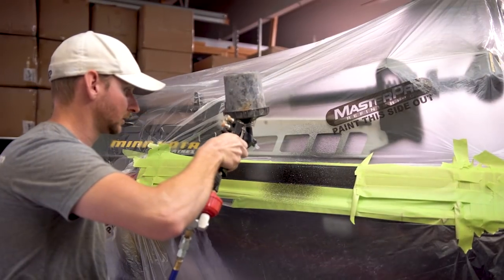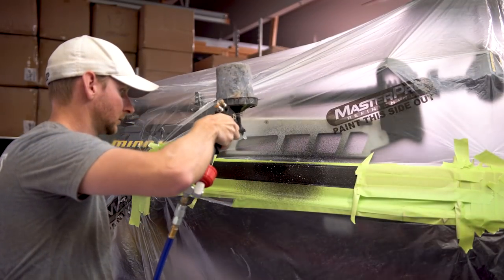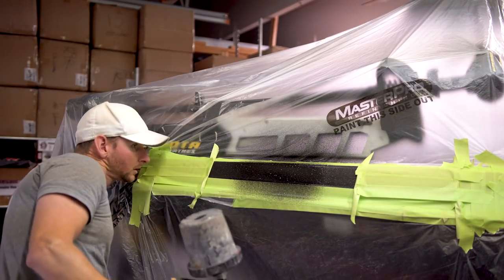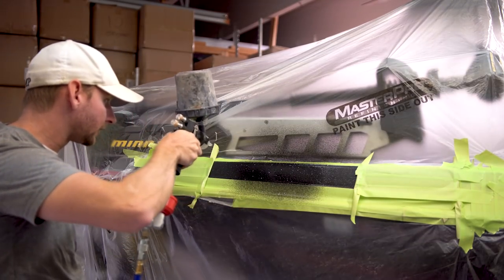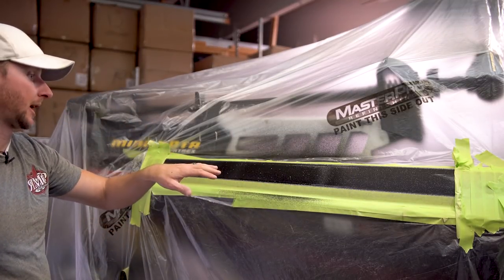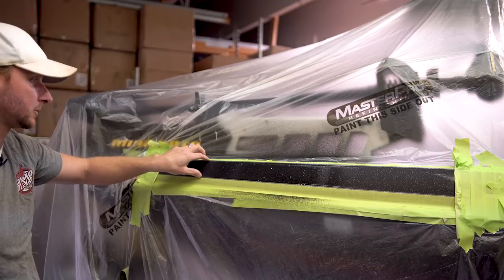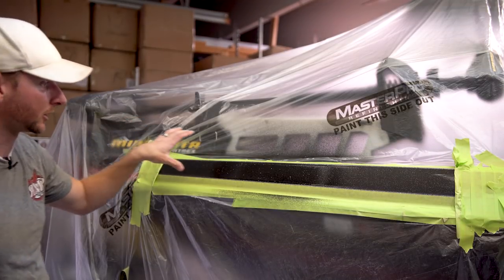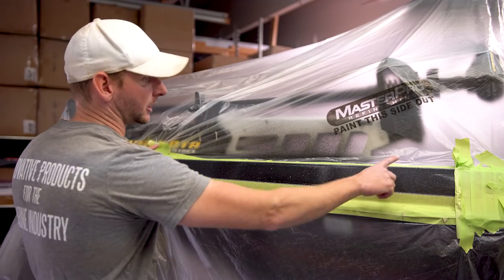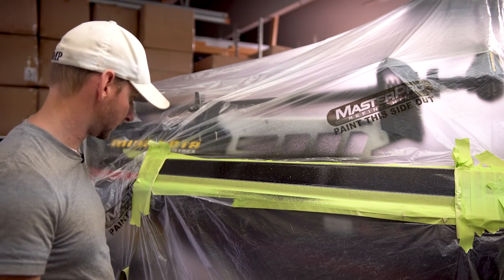Now that we have our clear gel coat and metal flake mixed, we're going to start spraying. I'm going to start on the area closest to the fading and work out from there — not all the way to the tape edges — because I want the clear to go further out than the metal flake, and you don't want a hard defined line where you stop your metal flake. Now that we have the tape pulled, once this area kicks and catalyzes we'll be ready to spray our clear. As you can see with the tape pulled, I've exposed the two pinstripes — the silver pinstriping on the top and bottom — and we will clear over all of this to help hide our blends and the transition from the black metal flake to the silver.